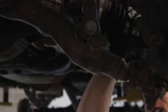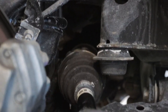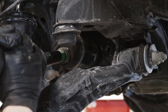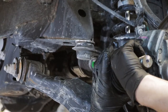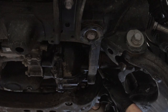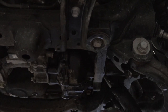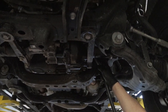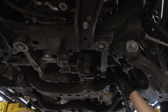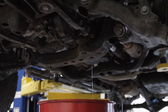The driver-side axle tends to go into the axle housing easier than the passenger side — I still have no idea why. Okay, that one's in — only took two tries. First try on the other one — nice. I like to overfill it and allow the oil to travel down into the extension housing, fill up the cavity by the pinion gear, then top it off once more and allow the excess to drain out, just to make sure we've got an exact amount in there.